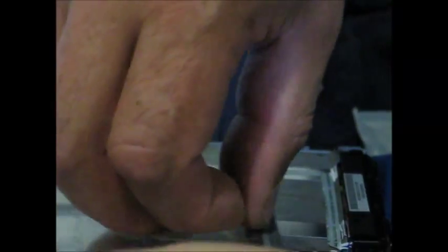Here's a new digitizer — they're about $10. They have lots of sticky stuff underneath here, down the edge, and they've got a peel-up section here to protect the glass on the inside from fingerprints and dust. If you peel this off, don't touch it. I suggest you don't peel this off until you're ready to put it on, because it's very easy to get dust underneath there and it's impossible to get it out once it's back together.